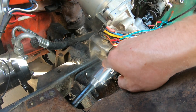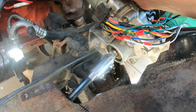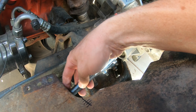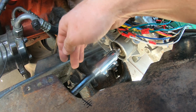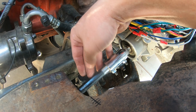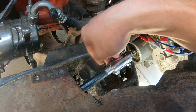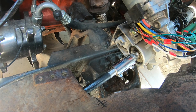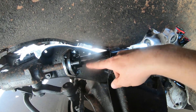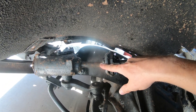This is a three-quarter double-D on both sides, and this was like 25 bucks. The website was like Johnny Law Motors or something like that — way cheaper than everybody else, and it's solid steel. Then the three-quarter double-D fits into the shaft so it can slide in and out and I can make it shorter or longer. This was out of an '84 to '94 Jeep XJ, which I think is the same thing as a Cherokee. A lot of people in the 73-to-87 C10 K5 group are getting rid of the rag joints and putting those on — basically just a bolt-in. It won't bolt in on the 67-to-72s though, so I just cut the ends off. The three-quarter double-D goes down to a one-inch double-D, then into the rag joint from Amazon — one-inch double-D with set screws — and then it bolts onto the factory shaft.